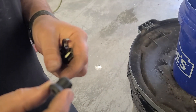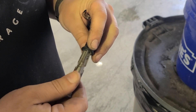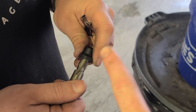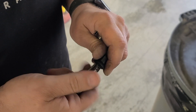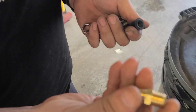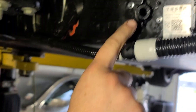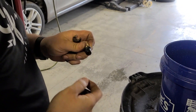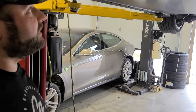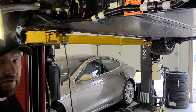Here's the nipple that we cut off — we filed it smooth on the backside. The reason for that is because we're going to use a pipe thread tap. I cut the threads in this. I used a rubber strap wrench on this and then tapped out the threads in here. We're going to take a brass nipple, use a sealant on the threads of course, thread that into the nipple, then tap this and thread it back into the battery. It's almost like it was that way to begin with. It's not a lot of pressure in the system, so the thread and sealant is fine. I've used brass in this coolant before and it has no reactions with it, so we're safe to use that.